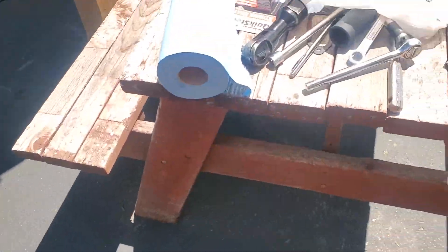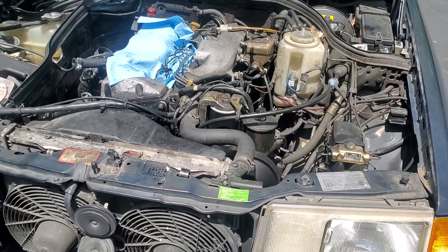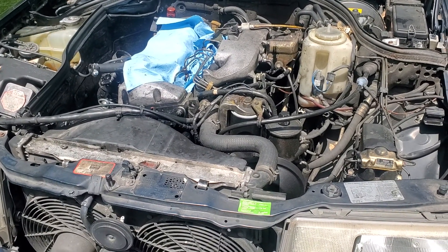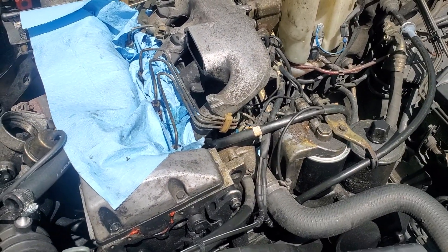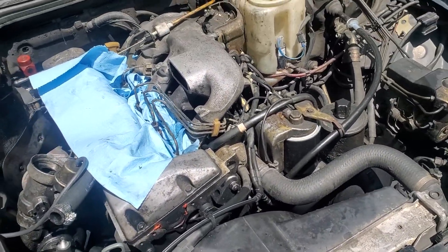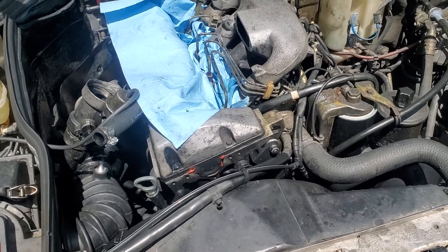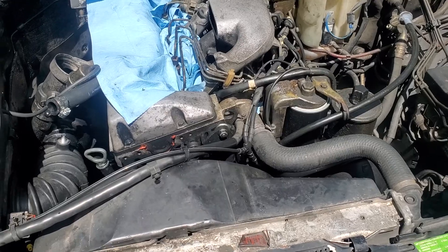Just by pure luck I was able to grab one of the surviving halves with pliers because I had room now — it wasn't being blocked by that little nub — and I was able to get it out. We have to go to a junkyard anyway to get some extra injectors, so I'm just gonna steal maybe two or three more bolts because they really like to strip. They're supposed to be Torx 30s — Torx 30 seems to fit in there pretty well but it still has some room. I don't have any 35s, all I have is 27, 30, 40, 45, but 30 seems to fit pretty closely so I'll continue using that.